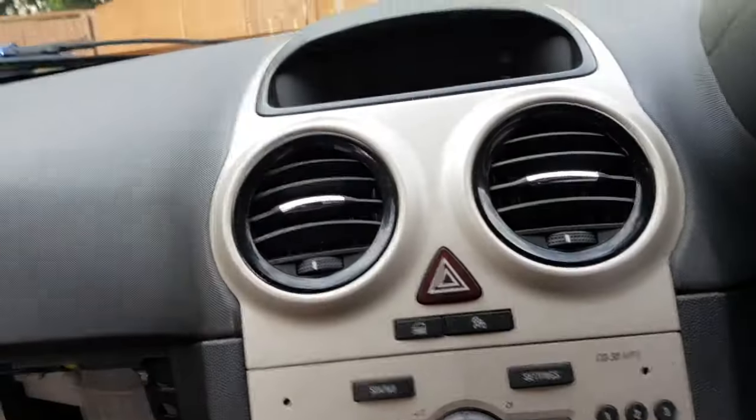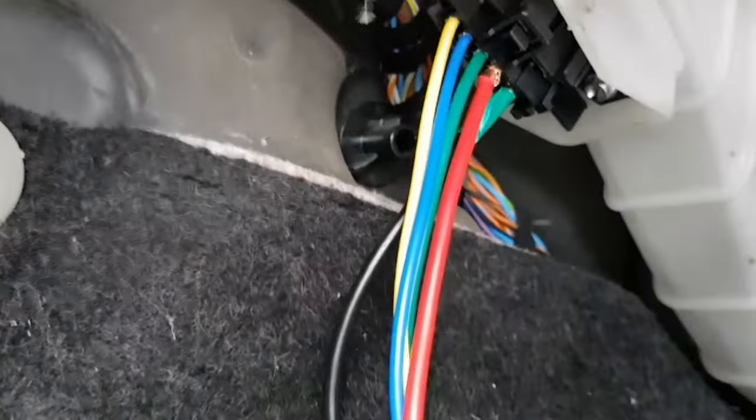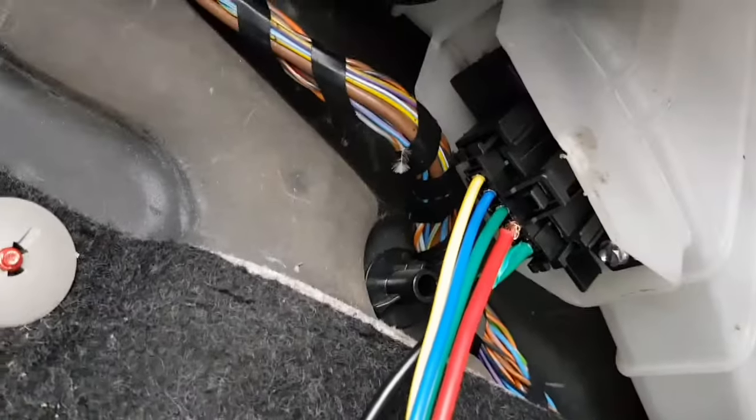That's an effective fix of your fan. If your fan still isn't working after that, there's a good chance it's the resistor. The resistor is held in roughly the same place — these wires go up into that little white housing underneath. Your resistor is held in by one little screw, very easy to get off, and you pull it out. But that's a story for another day.